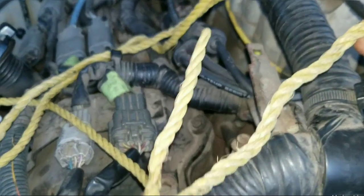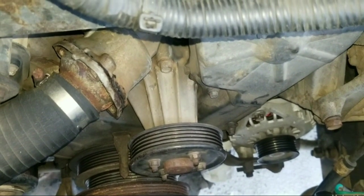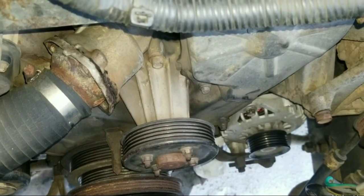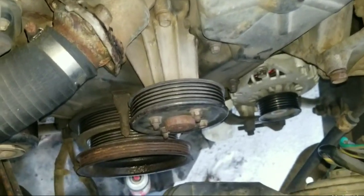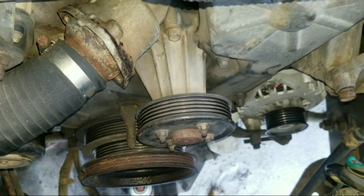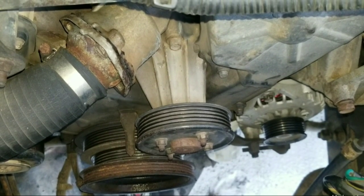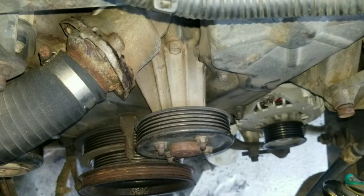What I want to do is replace the alternator belt onto the crankshaft pulley without the bolt in it. The alternator is going to need to charge the battery because we're going to start the engine and allow it to run, and see if that crankshaft pulley can break itself loose and start walking forward without the pulley tool. The heat from the engine is also going to play a role in removing that pulley, breaking up any rust that may be on the snout of the crankshaft.